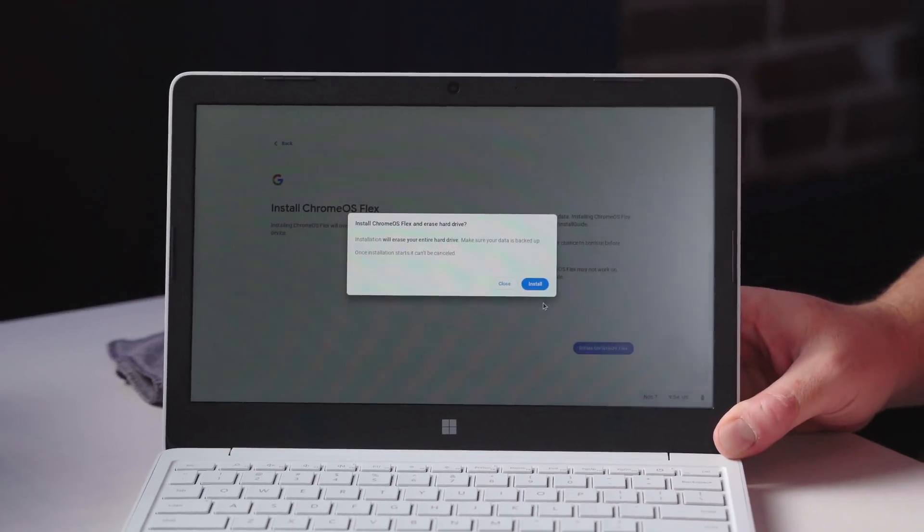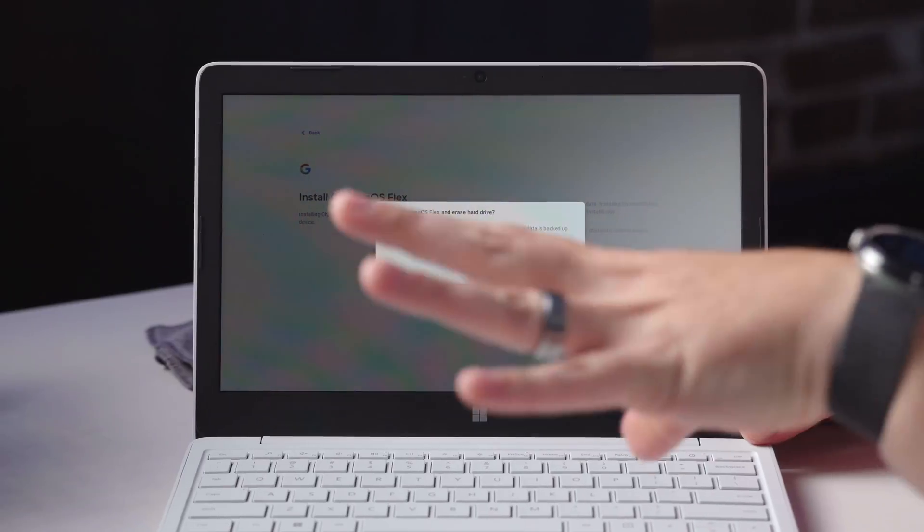I'm going to click the button and you'll see a warning pops up — this is going to erase your entire hard drive. So Windows and everything on it is going to go away after this. Now that's not to say you can't recover this device; you can get a recovery image from Microsoft if you choose. But it will delete everything and overwrite Chrome OS Flex to the entire partition of this device, which is 128 gigs. The installation says it could take up to 20 minutes; when we've done this in the past it said 20 minutes and took like five minutes. We're going to hop off and let this finish and jump back in the video whenever this part is done. Hopefully this one doesn't take a couple of days.